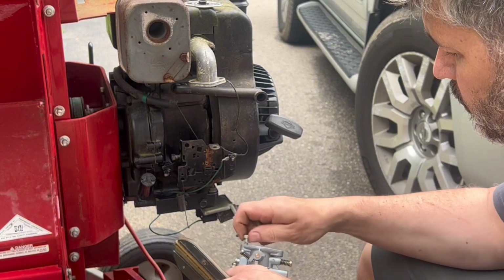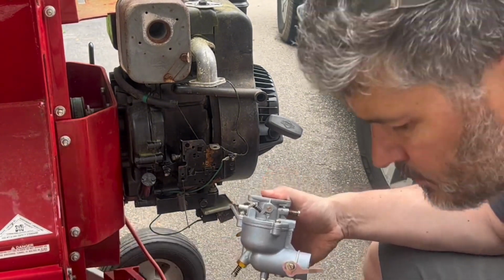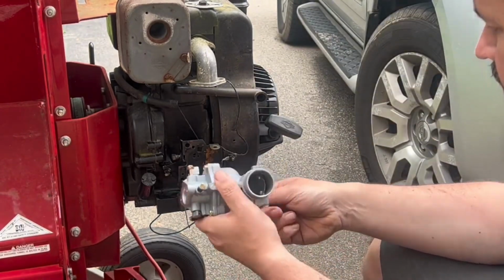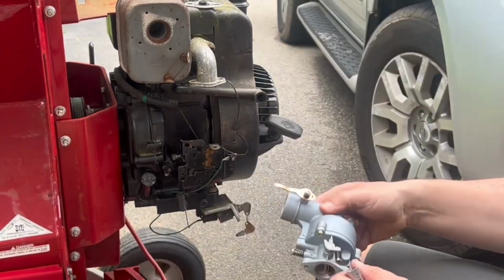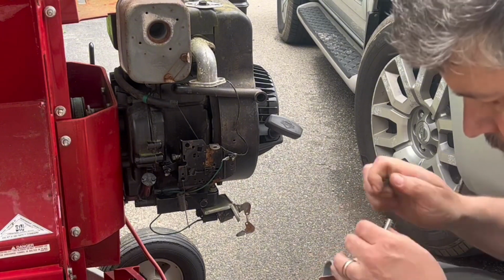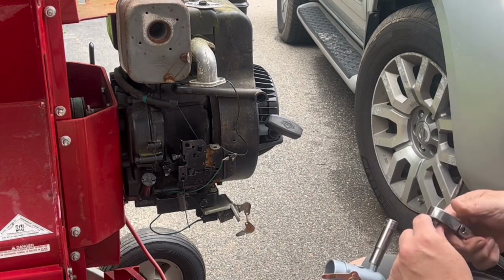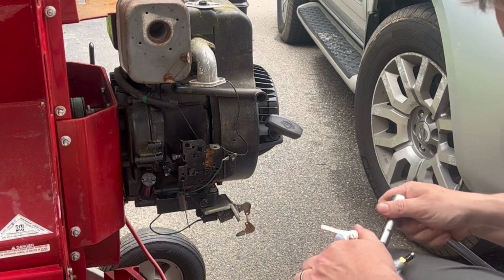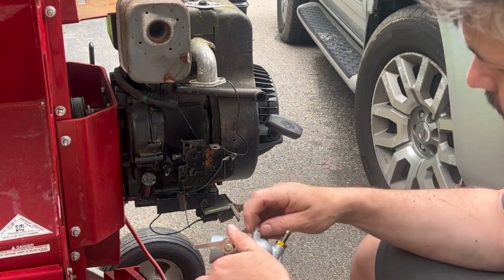Number one, the screws that they send you are metric, and so we took off those screws from that manifold that goes into the engine. Those are standard American threaded. All of the carburetors on Amazon have this problem. I think they're M6. You need an M6 20 millimeter, two of them, so that you can remount the carb to your engine. So that's the number one issue.